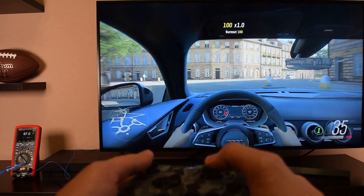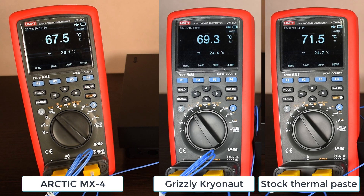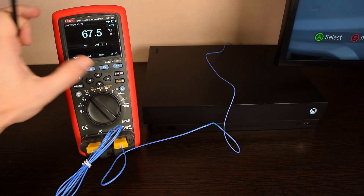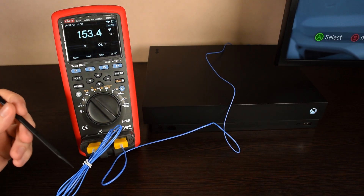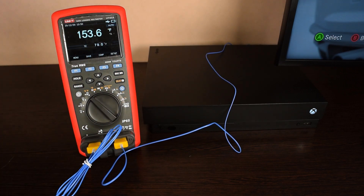Here's the final result. After playing for about 40 minutes I got a max of 67.6 degrees, compared to 71.5 degrees before the paste replacement — so it's about a 4 degree improvement. This is my room temperature reading which comes from a thermocouple, and the other one is attached to the heatsink right above the APU chip. So that's it, I hope it was helpful and thank you for watching.